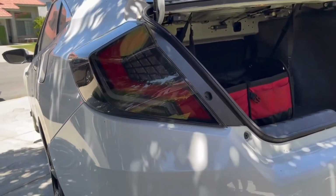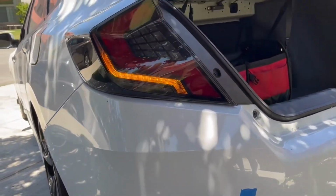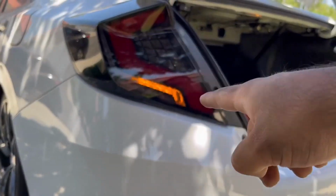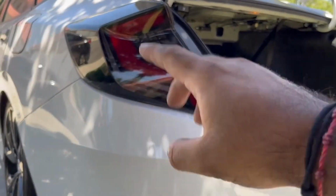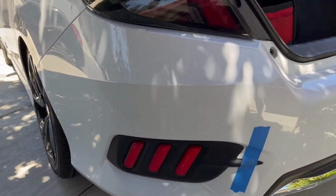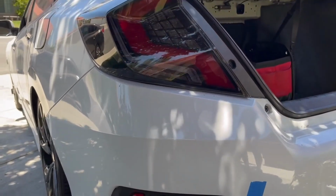Hell yeah, guys. Other side installed. We did it in shade. Look at that. Same process, everything the same. The only thing is on this side, for the turn signal, the cable is not orange like on the other side. It's a gray. On the green connector, it's a gray cable. The blue one was the same thing. It was a gray and black connector on a blue cable. But look at that, turn signals, and then it'll turn on when you hit the brakes too.